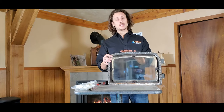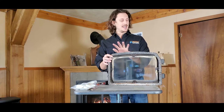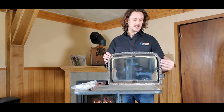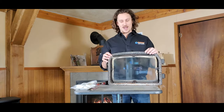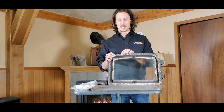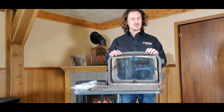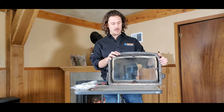Whether we're looking at wood stoves, pellet stoves, corn stoves, or coal stoves, we'll generally either see a cast iron door or a steel door, and we'll generally see a rope gasket going around the door that makes a tight seal to the stove body itself. Over time this gasket can get worn, frayed, or compressed down, not making a tight seal all the way around, which can cause safety issues and definitely a lack of combustion efficiency in the unit.